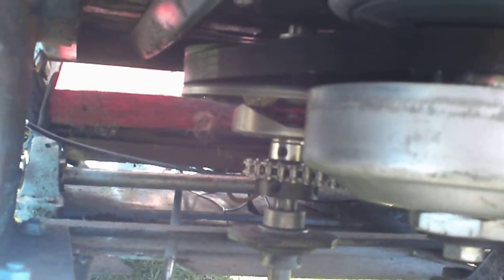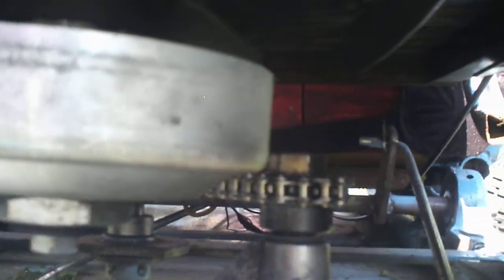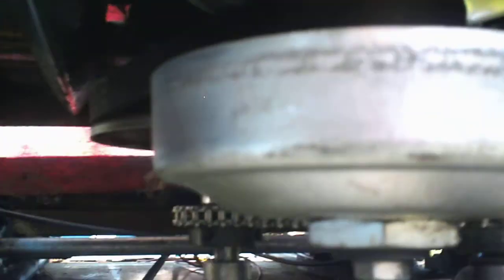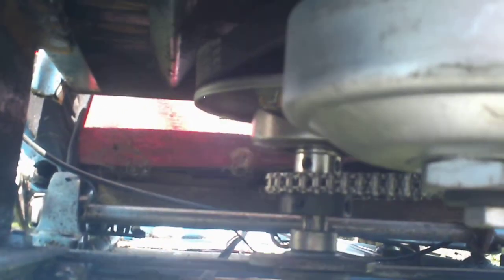The belt runs back to the driven clutch on the jackshaft, then from there a sprocket and chain runs to the actual lawnmower gearbox. I had the larger of the two gears on the gearbox — things were super torquey — so I switched it around to get more speed. I can tell a big difference. It's still really torquey, so I'm thinking about doubling the size of that pulley on the jackshaft to give it more speed.